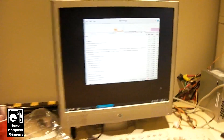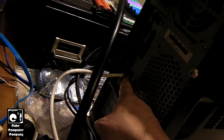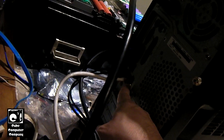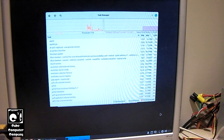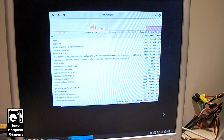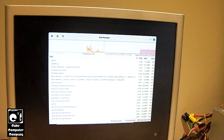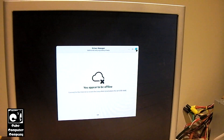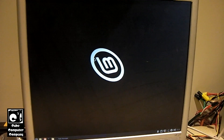When we look at the Ethernet indicators, you can see they're obviously working, but the OS is not picking up a connection. I'm thinking that's probably a driver issue — not 100% certain on that. You can see we're sitting idle at 36% memory usage. Of course a little bit of memory is being taken up by the integrated graphics. So I guess for now the tour of Linux Mint XFCE on the Trash Am 2 system is going to be short lived.